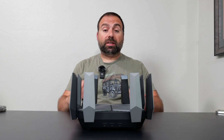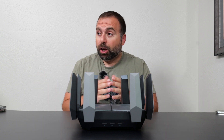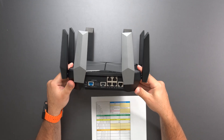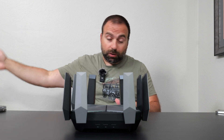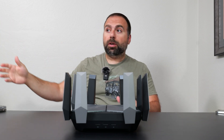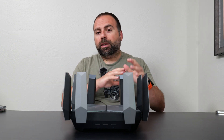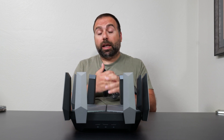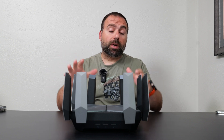Let's get into the internet speed test. No matter how fast any router is, when you're accessing the internet you are limited by your internet speeds. For me, that's 5 gigabits per second upload and download. Thanks to the 10 gig per second capable ports on this thing, I can actually get my full 5 gigabits. When I do the speed test using my computer hooked up via Ethernet — and I also have a 10 gig card on my computer — I can get to those numbers, so I get full 5 gig up and down very easily. You also need CAT 7 cables, or CAT 6A or CAT 8 cables work as well. As long as you have all the right parts capable of getting to those speeds, this router will easily get you there.